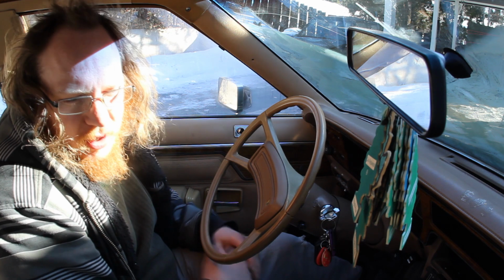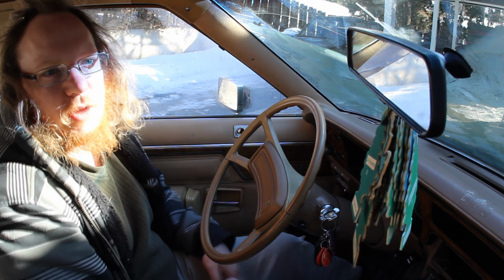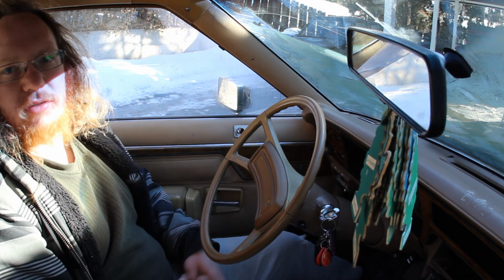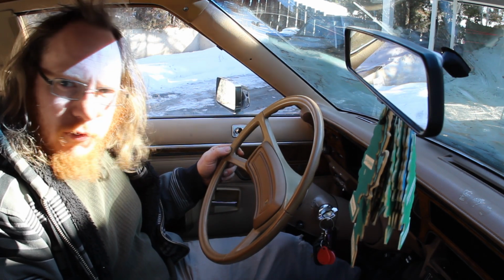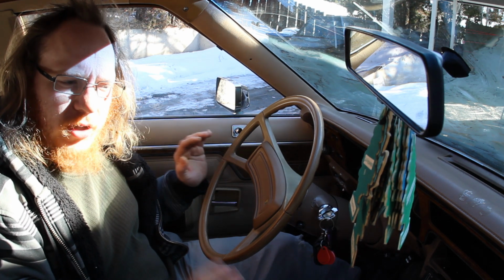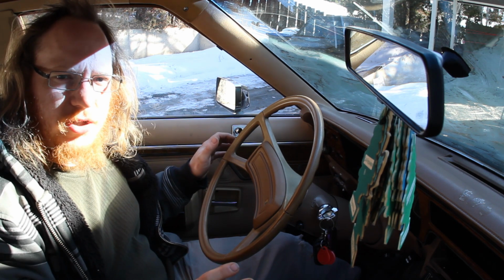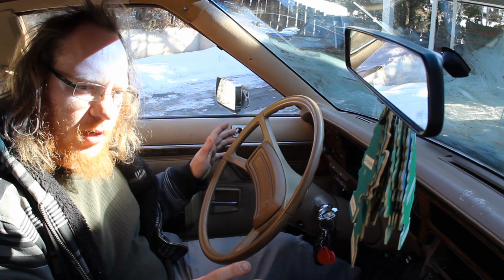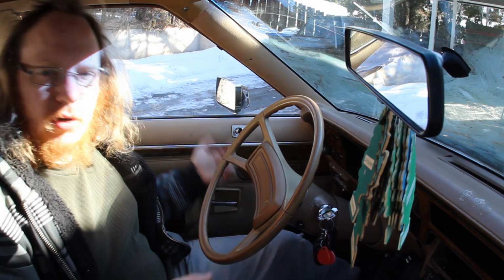And again, if I want to go outside of the vehicle now or something like that, or I want to actually go into the house and get warmed up, too bad. I'm going to take my foot off of the accelerator now, and it will just stall. It's been about 4 minutes now since I've had my foot on the pedal here and the engine's been idling. So I'm just going to ease my foot off the accelerator, and now the carburetor and the engine should be just warm enough that it'll be able to sustain itself in idle while running rough. There, okay, foot's off the pedal.